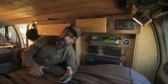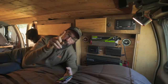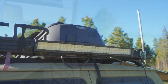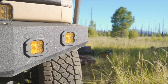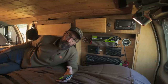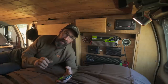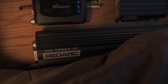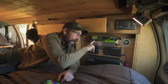When I do turn the key on, it still works like a normal car stereo. I've also got the reverse light bar hooked up so it automatically comes on when I go into reverse. All my Diode Dynamics lights on the front are set up on my high beams, so as soon as I click on high beams they automatically turn on too. You can set those triggers up any way you'd like, just by supplying a switchable 12-volt source to the trigger points on the RedArc Red Vision and programming which circuits you want to activate.